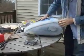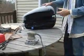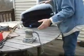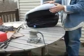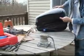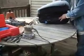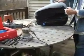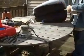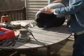Okay, so you can see the motion of making the sanding, and obviously this is a home done deal. A more professional body shop would maybe have the tank held onto something, bolted onto something. Nonetheless, we need to get into the bottom a little bit. I'm not going to worry so much about the bottom of the tank. I'm going to quickly hit it with an 80 and just do a scuff so that it can take some paint. It'll hold the primer, and once that's done, you can just put a color inside. But moving along quickly is so important. You've got to move quickly and smoothly.